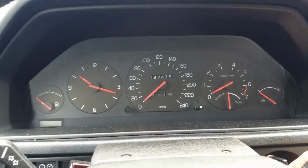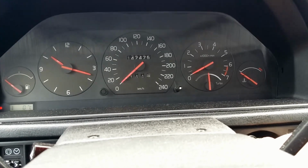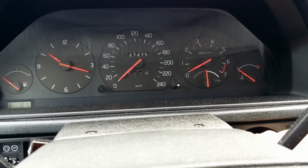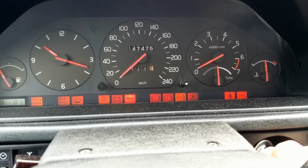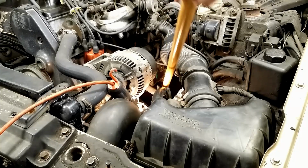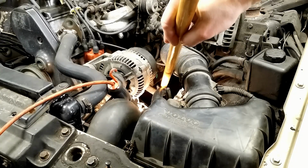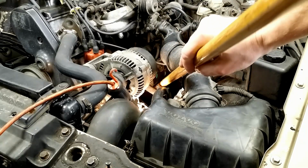So you get into your car, turn the key, dash lights turn on, but the starter doesn't crank the engine. You can only hear click, click. Take a broomstick or something similar and tap the starter. It is located somewhere where the engine and transmission come together.